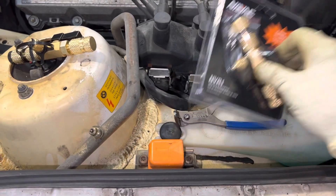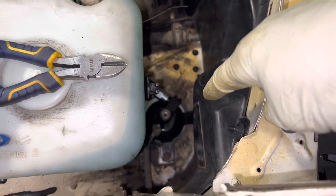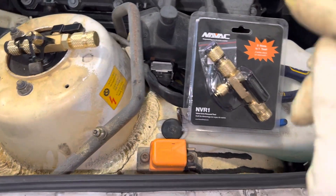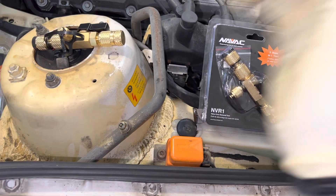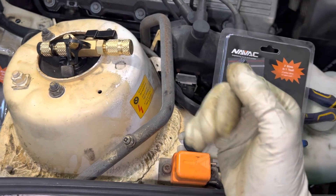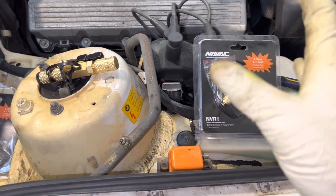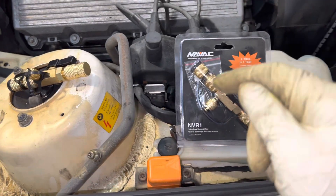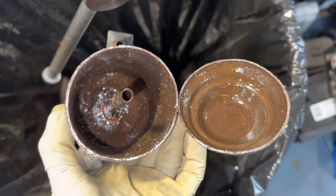I have a full plate for tomorrow. They're going to change the expansion valve on this because this was a moisture-contaminated system. They already put the new compressor on, but they didn't know they needed a new receiver dryer. I told them this system most likely has moisture contamination — because if shops tried to do a leak test using shop air, or had contaminated refrigerant from an old machine where they never changed their desiccant bag, it will be all rusted out. And to prove that, this is what the inside of the receiver dryer looks like — though I haven't released that video yet.